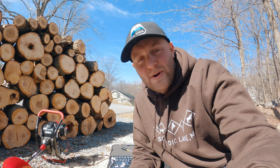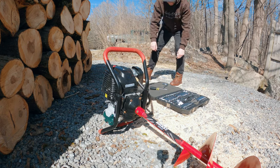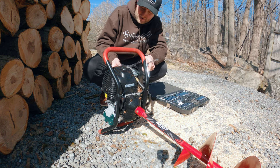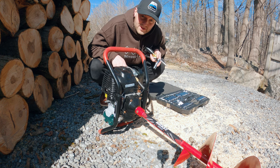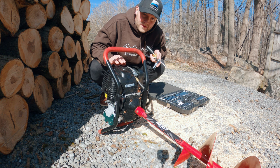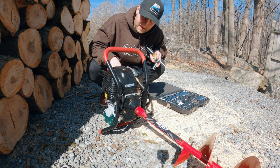So if you're watching this and it's too late, I'm going to show you guys right now how to fix hydro lock. If your auger's feeling like when you're trying to pull the cord to start it and it just won't even budge, it's because you stored it incorrectly and some oil leaked into the cylinder, and it's bogging it up in here causing it to kind of be like that.